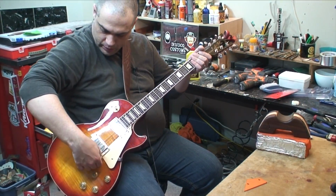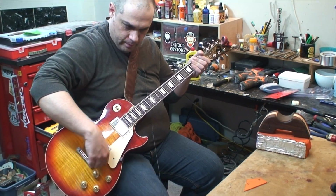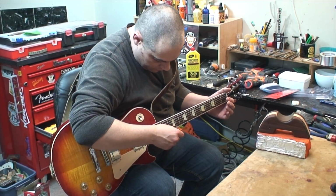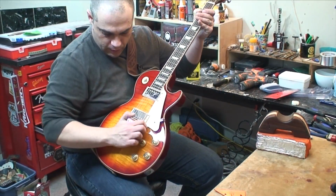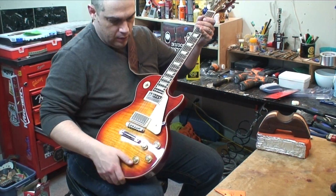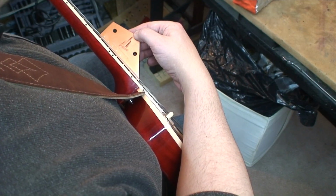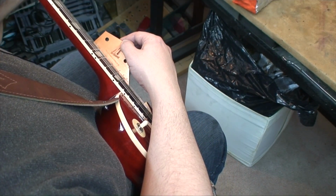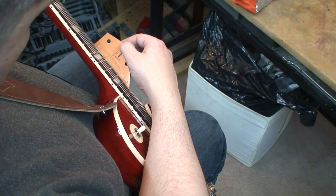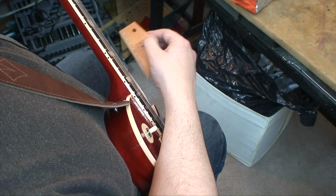All right, all we gotta do is drop it down a smidge. See where she's at. Still 4. Couple turns. I hope you can see that. This tool's nice, easy to see. What do we got there? It's just right on the line for 4/64ths. So that's just about where I'll leave it for Richard.